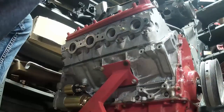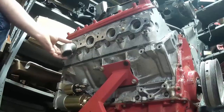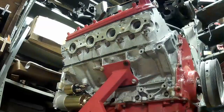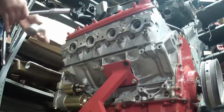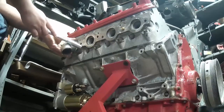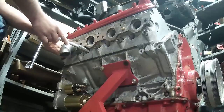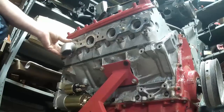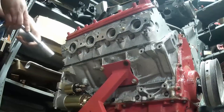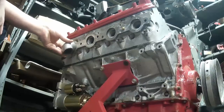Next, I want to take one of my weld elbows. I've got my spark plug holes here. I want to angle this away from the spark plug holes but not so far that I can't get a ratchet in there. So let's grab a ratchet real quick. Now I've got my spark plug ratchet and extension and I can compare. If I go up too high with this I'm not going to be able to get by it. This is going to have to be something pretty close to vertical — if I clock it up too far I'm not going to be able to get my socket in there and change plugs. The real one is pointing out into space and that's not going to be bothered, but this one is kind of a little bit critical.